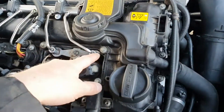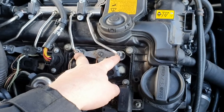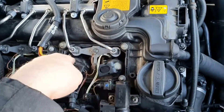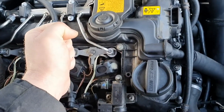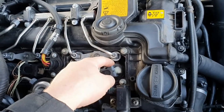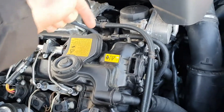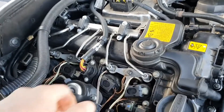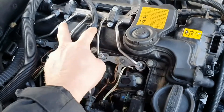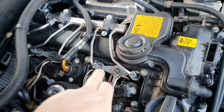The injectors are basically bolted into the engine cylinder exactly like a diesel — it's direct injection. These injectors are injecting right next to the spark plugs, so you get instant combustion and the fuel is still a vapour as it's injected. It's injected under high pressure straight into the cylinder itself, right next to the spark plug. The air isn't actually pulling the fuel down like it used to when you injected into the inlet manifold.